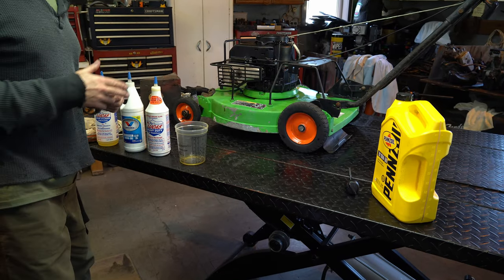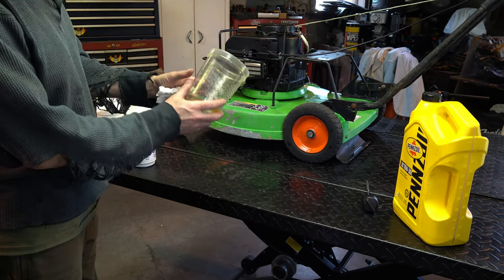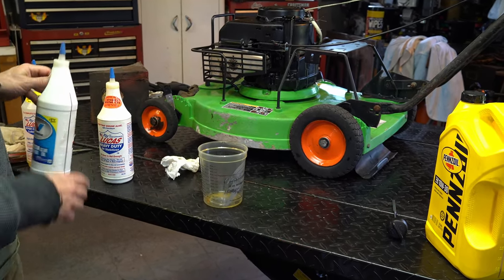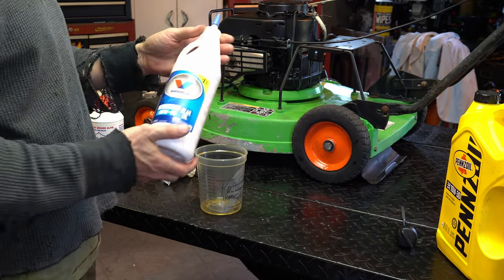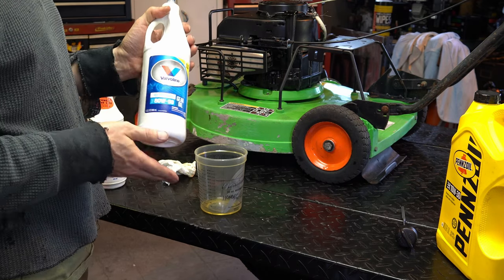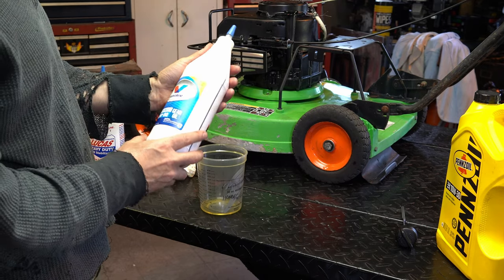All right, so these motors take about 24 ounces, which is marked about here, all right? So we're gonna start off by adding in some flavorants, some secret sauces. 80W90, she's burning oil, okay? We gotta make it stop. And this has got a bit of sulfur in it. It's gear oil, your basic gear oil. Good stuff, all right? Got a little bit of that sulfur.